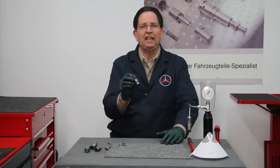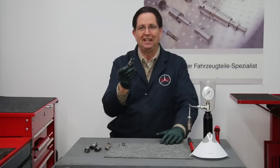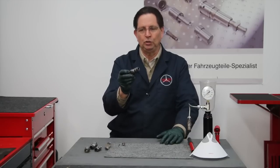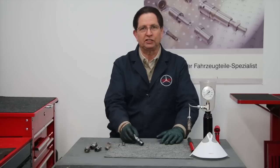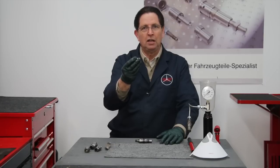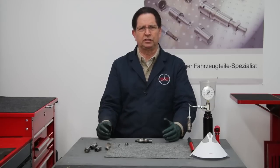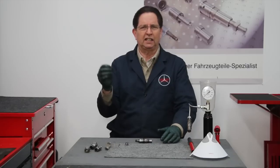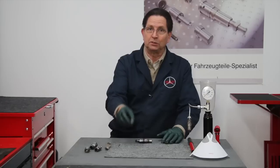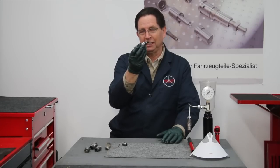We're seeing some new problems develop with these, and it's largely due to age. Some of these are getting lots of miles — we're talking hundreds of thousands of miles. People keep trying to use these housings when they rebuild their injectors. We don't have these parts new; all we have are the nozzles. We're getting reports of people putting new nozzles in and saying their injectors aren't firing properly, or they're making funny clicking noises, clattering. And we're finding out the problems are not related to the new nozzles — the problems are related to these old housings.